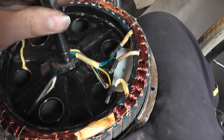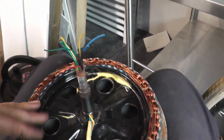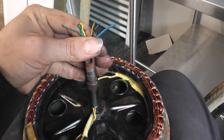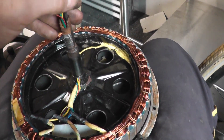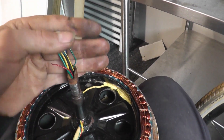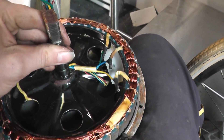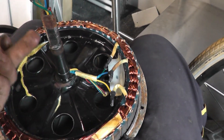So I put some heat shrink on the damaged inner cables — there were a few damaged ones. I don't have enough of this cable lying around, I don't have the proper hub motor cable and I'd have to order one, and that involves waiting. So I'm going to repair by soldering onto these. Because I've got shorter pieces of it, I'll cut these in here and extend them inside and then push this through a bit more.